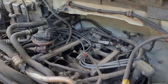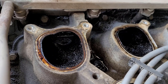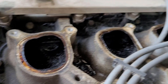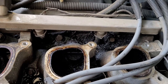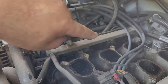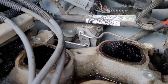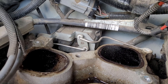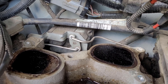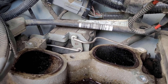What that means is there's a series of butterfly valves down in your lower intake — you can see one right there through that port, just like on an old carburetor. Each port has its own valve. There's a series that runs this way for these three cylinders, and then a row that runs that way for those three. And this back here — the thing with the two metal linkages going to it — that is your intake manifold runner control valve, the IMRC valve.